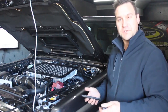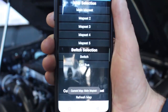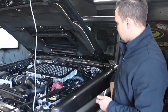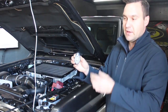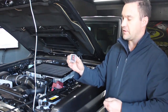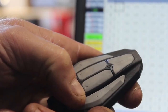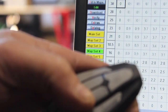There are three different map select options for a Unichip. There is a Bluetooth option which connects with our Unichip app, available for both iPhone and Android. What's been fitted to this car is the RF switch — like a garage remote with five numbers plus two extras so you can program a garage door or electric gate. And last but not least, probably the most popular setup, is the membrane style in-cab mount. When plugged in, you get a red LED behind each number and simply press the up and down arrow while driving to change the map. As I change through maps one to five, it changes the map set on the Unichip program.